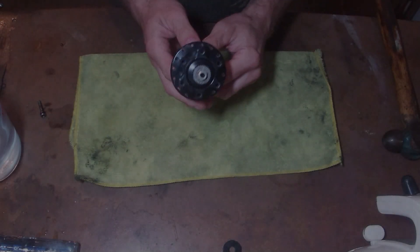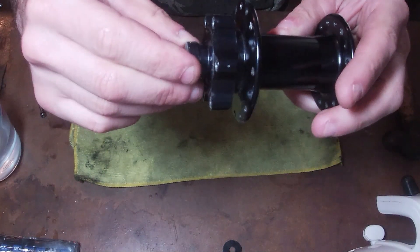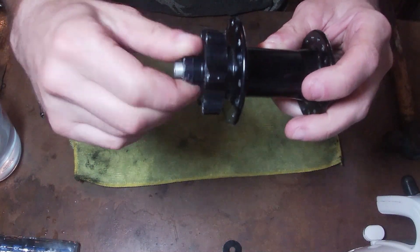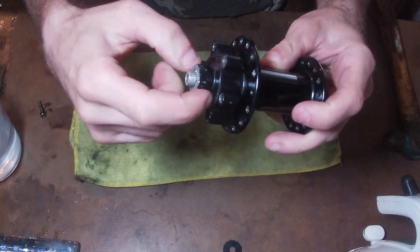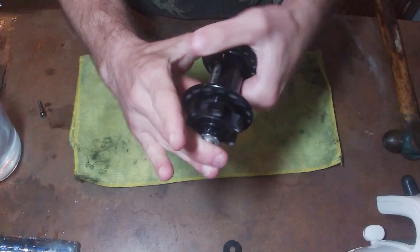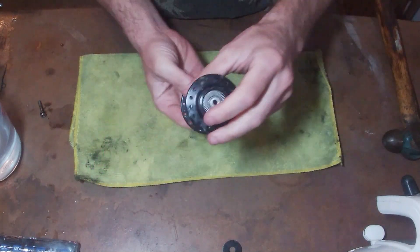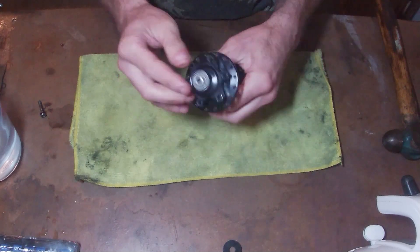In this video what we're going to try and do is remove just the end caps. You can hear this one - it's a little bit noisy and I don't know if that's grit stuck on the end cap or if the bearing is dead inside, but the whole hub is a little bit noisy and there's a little bit of vibration coming through it when I spin it. I suspect there is a dead bearing somewhere.